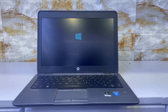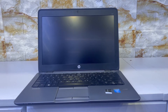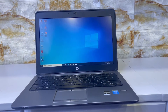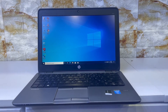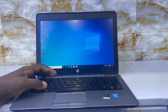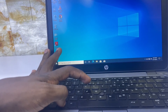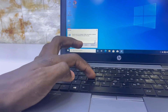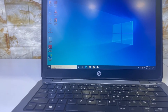I'll first switch it on, then we'll go to the properties and confirm or verify if this computer has been upgraded. There are very many ways of checking RAM in the Windows graphical user interface. I press the Windows key plus R, then I write 'dxdiag' — D-I-A-G. It will help us display the DirectX Diagnostic tool for Windows, which will show you the amount of RAM.